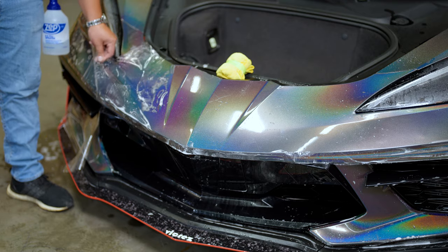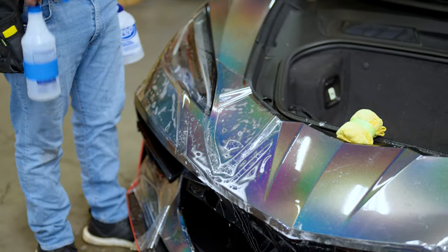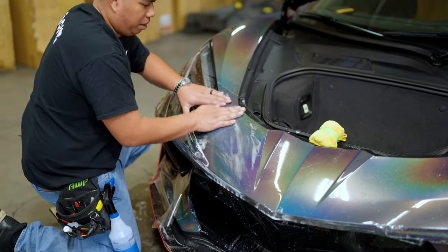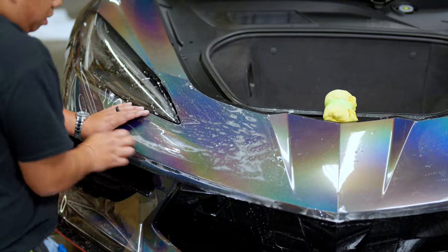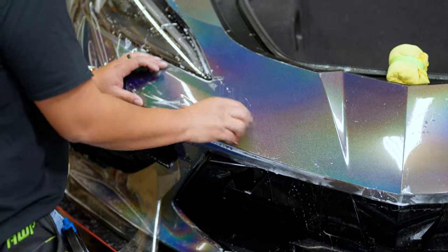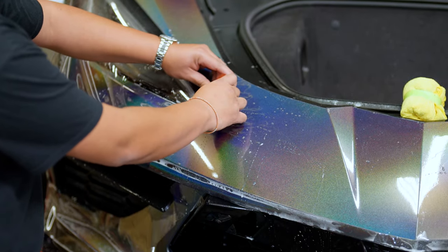Now we're going to work towards the other top side. So we're going to grab some slip solution, spray it towards the middle, make sure our film is moving freely. Then we grab our tack solution, spray our film, spray our corner, now we're going to pull it, hold it in place, get rid of all those air pockets. Make sure we have no dry spots. And we're going to squeegee lock down the bottom, make sure we have no water running down, work our way to the top, overlapping our strokes with the squeegee. We have a finger here, so grab our tack solution, squeegee hold, squeegee hold.